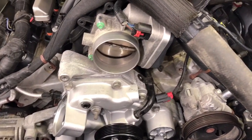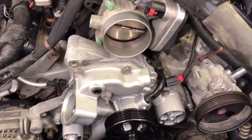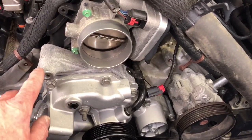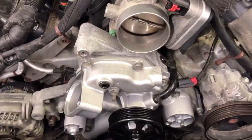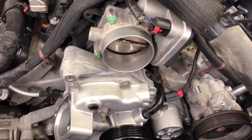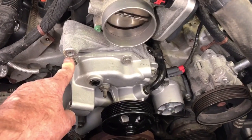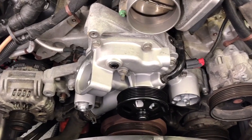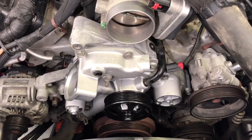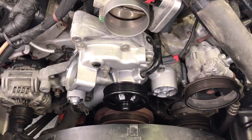When you go to put all the remaining bolts in, I put them all in and just snug them finger tight, then start tightening them in a crisscross pattern — start at the top, go to the bottom, come back over to the other side at the top, back to the bottom, and go crisscross like that so you get them all snugged up evenly all the way around. Don't forget the center one. Then go back and tighten them all over again. At the very end, just start at one bolt, count them as you go around the outside — ten bolts — so you know when you've got all ten tight. From here it's self-explanatory: put it back together in reverse, start with that lower radiator hose first, then toss your pulleys in, and that should be about it.